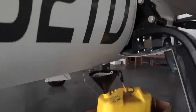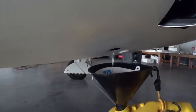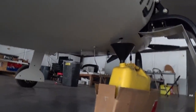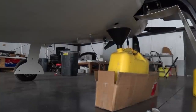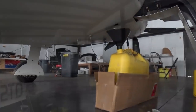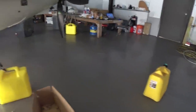On to doing weight and balance with empty fuel. I decided to drain all the fuel out — I knew I had about 21 gallons on board. I got four containers, two I already had and two new ones I picked up. I pulled out the little sump drain out of its fixture so the fuel could just drain right out of the bottom of the header tank, and it didn't take too long to do the first bit.